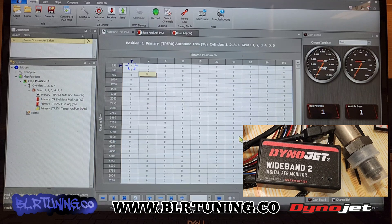Remember, we're not doing anything as far as live data. So if you make any changes in here, like you accept the trims from Auto-Tune, when you're done you need to hit send map in order to send that back to the Power Commander. So what we need to do first is go up here to configure — this is the first gear wrench icon over here to the right.